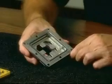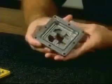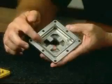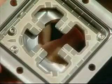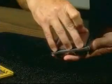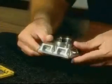What I have here is the spray cap that delivers the spray cooling to our MCM. You can see four spray nozzles per processor chip and one spray nozzle for the cache chip. The cache chip runs about 40 watts and the processor chip runs around 100 watts. The pattern matches the MCM, and this gets mounted directly onto the MCM, sealed and tested at the MCM vendor.